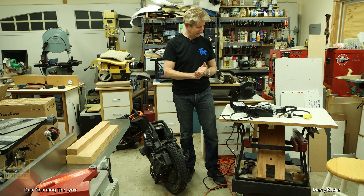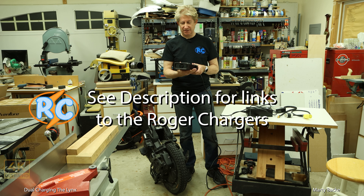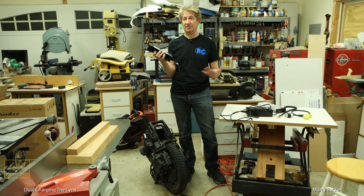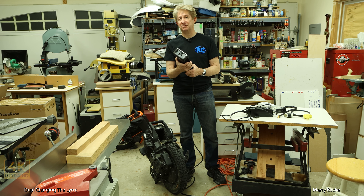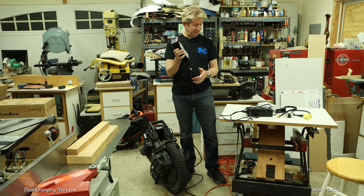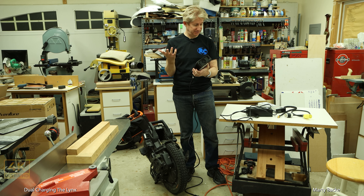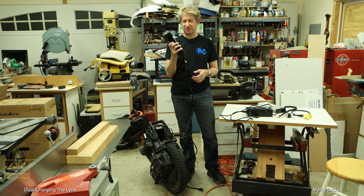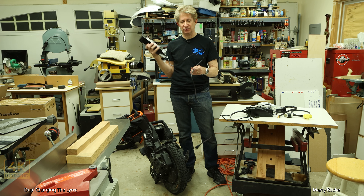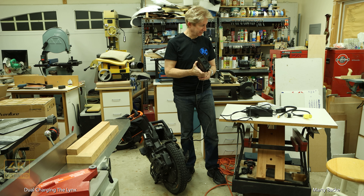In general, I've been using the Roger Smart Charger for all my wheels, except for my 100-volt wheels since this doesn't go down to 100 volts. But I can charge the S22 up through the upcoming 168-volt wheels. So this is my primary charger, both when I'm out and about and need to charge away from home, and also at home. It's just super convenient to use. This can go up to about 2,000 watts of output. On 110 volts, like in the United States, it's pretty much limited to 10 to 11 amps — I basically consider it a solid 10-amp fast charger. Quiet, love it. Really easy to configure.